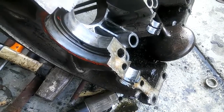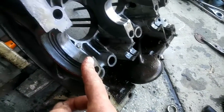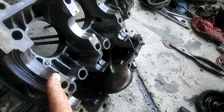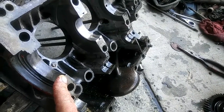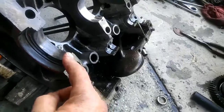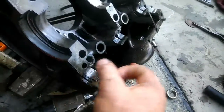It'll create a lot of speed. Maybe put some Lucas in there to keep it running that way — it's not like it's gonna go a million miles an hour. Then I'm going to measure the barrels. I don't know if those are big bore barrels; I know they've been replaced. In fact one of the pistons — they look like Kolbenschmidt pistons so they're probably original.